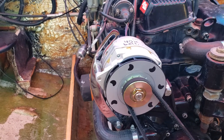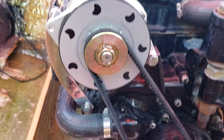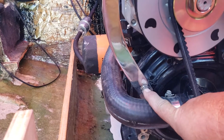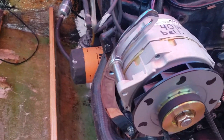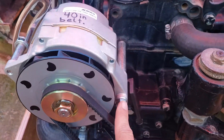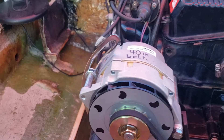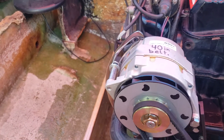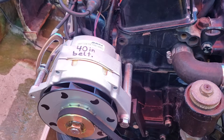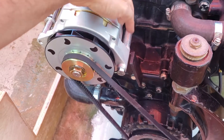And then I also had to get some hardware, which was a few bolts. What you'll need is two 5/16 by 2.5-inch hex bolts for this location here and this location right here. You'll need a metric bolt, an M8 by 60 for this adjustment bolt here. You'll need a 7/16 by 6-inch bolt for going into the head here. You also need some washers — lock washers and flat washers. I put them on each side so it slides real nicely. This piece right here going over this bolt is a piece of 3/8 water pipe — a 3/8 by 6-inch nipple that I cut the threads off and cut it to exactly three inches long. That gives you support there.